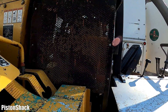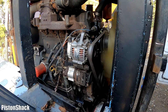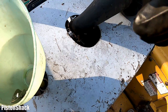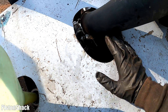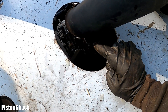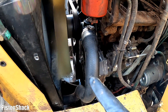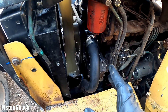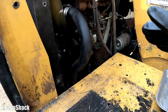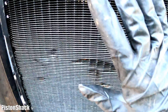It's warming up. Be very careful with the fan. Engine is cold, thermostat is still closed — we have to warm the engine up to operating temperature. We want the thermostat to open. Meanwhile, when the engine is running I like to go and check for any leaks.